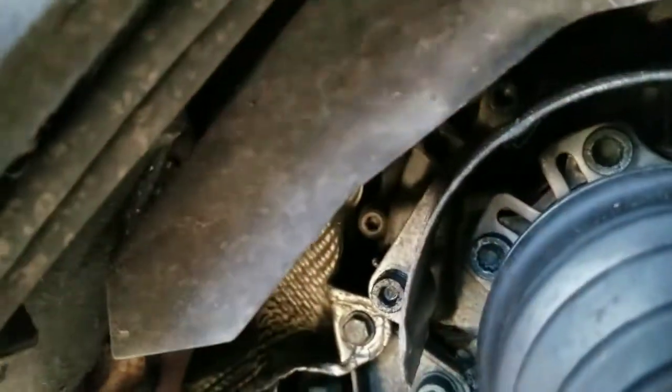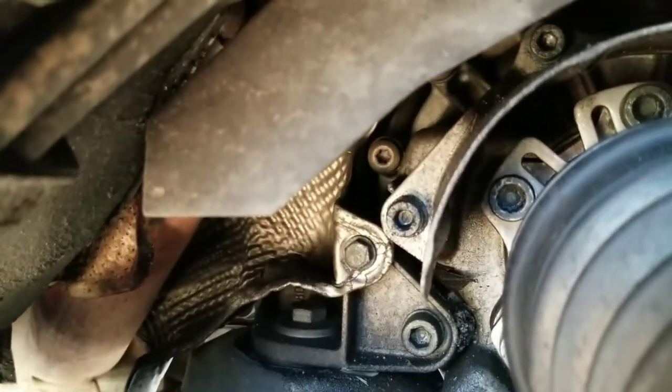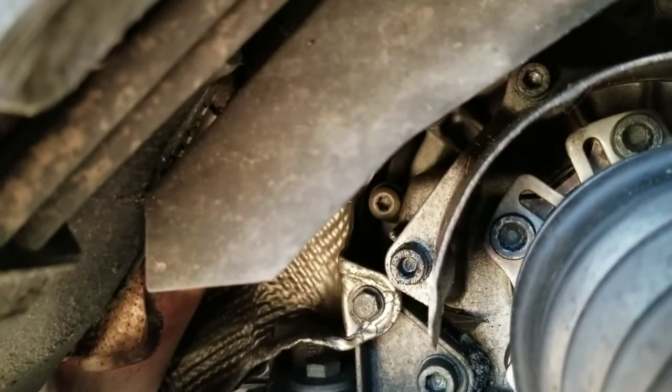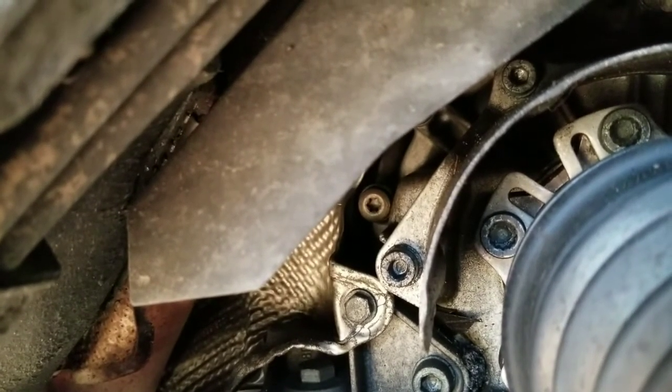But any of the bolts for the transmission bracket heat shield that you can see, go ahead and start undoing those. Those are going to be 10mm bolts because you're going to need that to be removed to be able to take off your heat shield bracket. If you can't get to them all right now, that's fine, because once parts start coming off, it'll be easier to get to. And then from that point, you get to the rest of them.